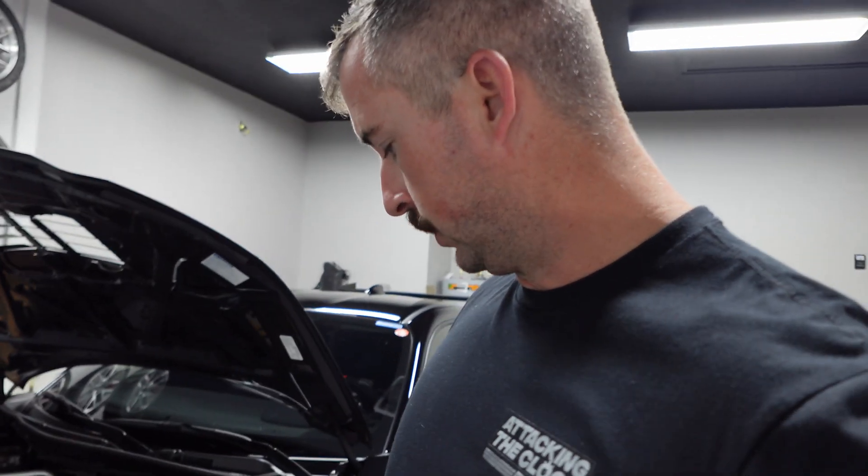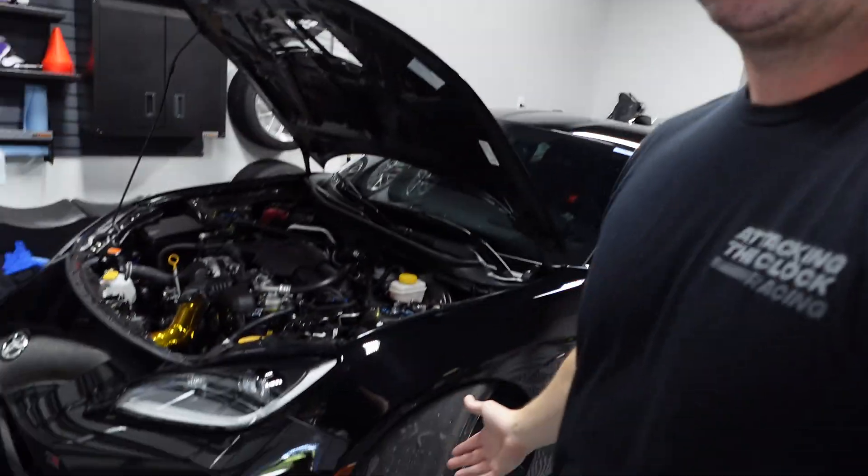On this fluid I did a track day or two before we did the pads. At Sebring, turn seven is the hardest braking zone on the track and I felt — I'd describe it as kind of icy — I'm pushing more in the pedal and not really getting the feedback I want. It could be the stickier tires or the added aero, so I'm going to change the fluid to check that off the list. We're going back to the track in a week, so we'll swap off the Hoosiers and put the super 200s on.